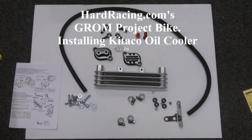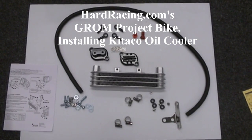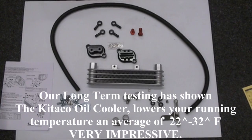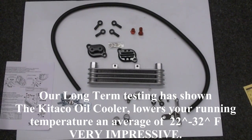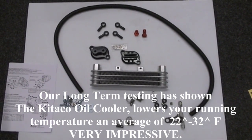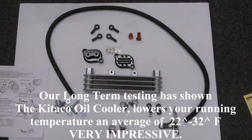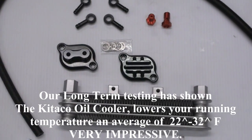And this is Kitaco's oil cooler. That's specifically made to work with Kitaco big bore kit or the Kitaco clutch cover that we carry. It's all nice hardware, mounts directly up to a stock Grom head or a Finbro head. It'll work with either one. Anything that uses stock tappet covers, because that's where it mounts to, is the tappet covers.